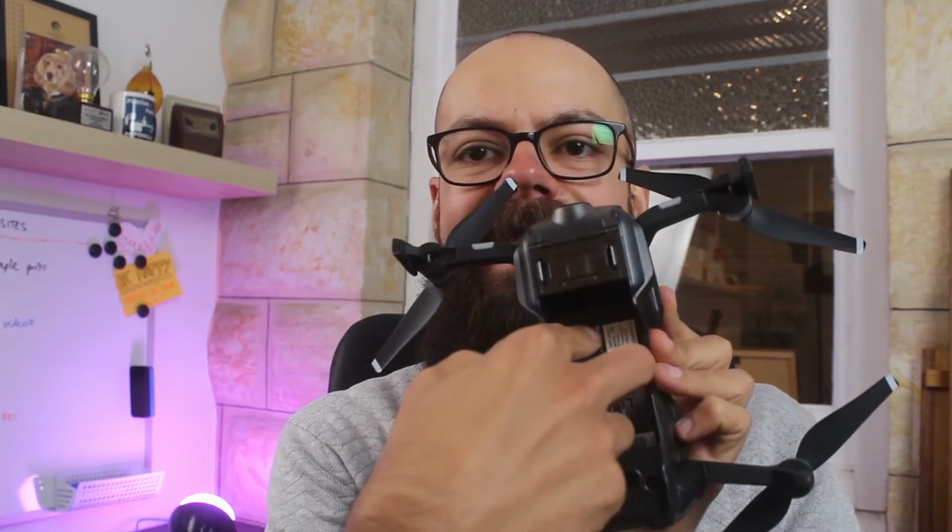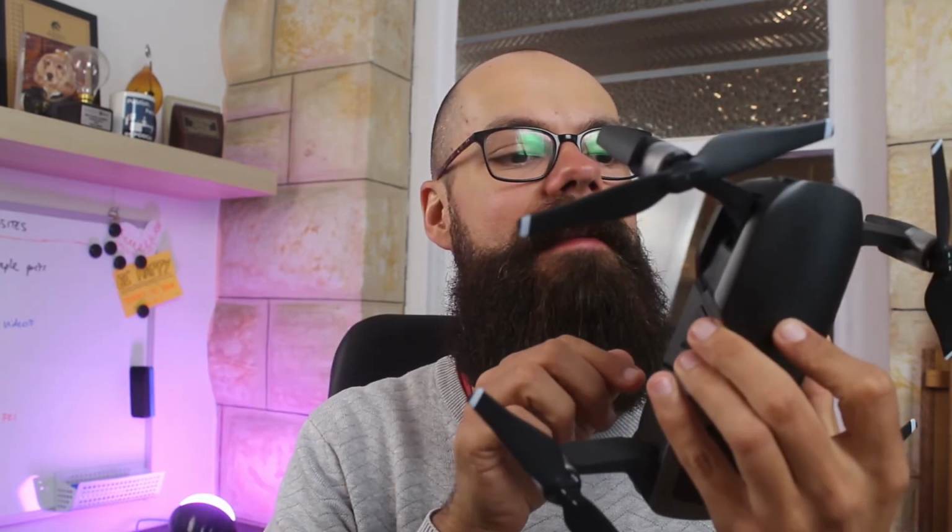Overall, the battery is the first thing you should check, because then you're going to take your drone and put it in, and you're going to wait for that little click. There are tabs on the side that tell you whether or not it's been properly connected, but what you're looking for is a battery that connects well. And I should have said as well, look at the connectors inside the drone for any sort of bending or warping or corrosion. This should all be nice and clean, with no discoloration, and there's a satisfying click when it hits the tabs and everything fits into place.